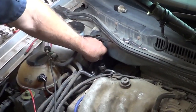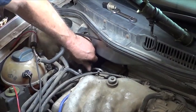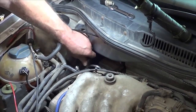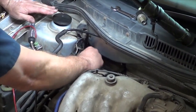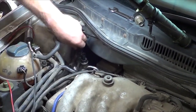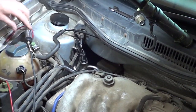I have a good used one here — I'm wondering if I should swap that in or just wait for the new one to arrive. We'll get the sensor changed out. A 17mm wrench works here — I like a shorty. This will make a pop when it releases. There's a Schrader valve underneath it so you don't need to worry about losing Freon. There's the pop — and here's our known good used one. I'm not going to tighten it all the way because we'll be changing it out with a new one when it gets here. Plug that in.